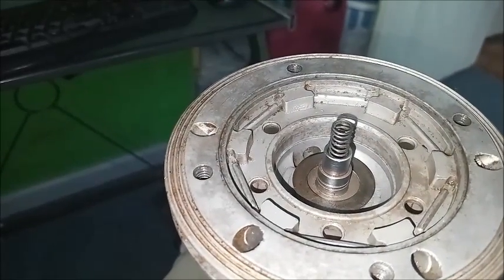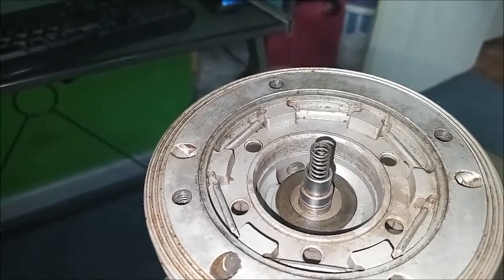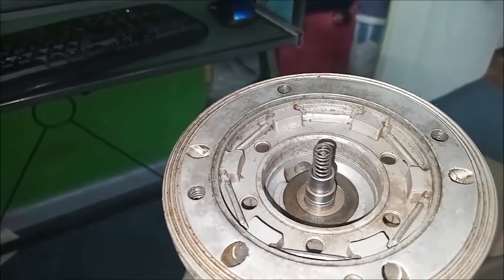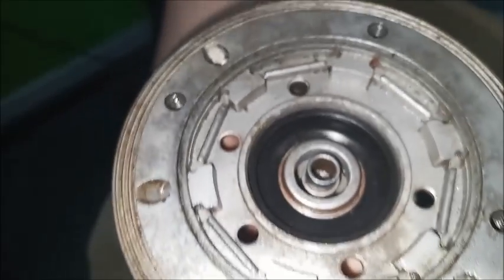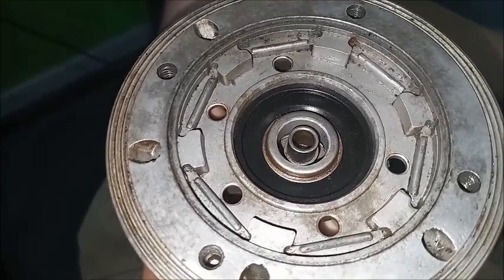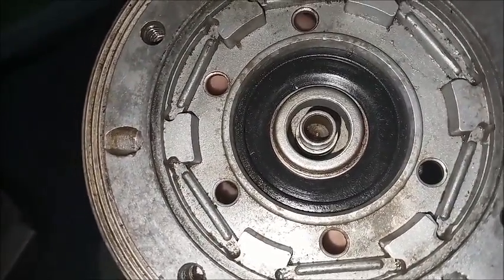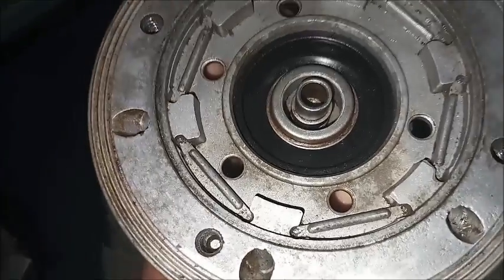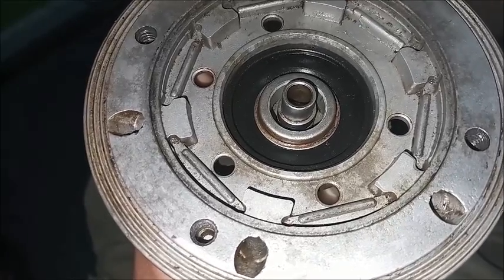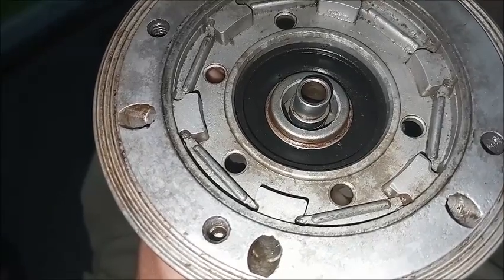Holding is able to work the way it does because of the spring. So you apply the brakes, but then you stop pushing it. The spring pushes this back down. But your foot is on the other end, so they get an equilibrium. It's the rubber diaphragm that does the blocking of the atmosphere and only allows it to come in this way. And then the rubber ring below controls, as shown before. So, released, applied, holding, released, applied, holding, released.